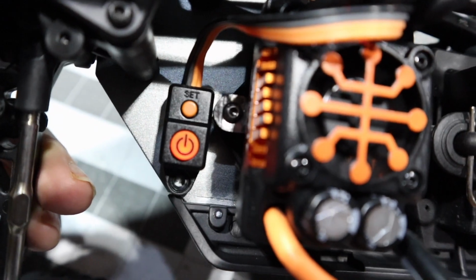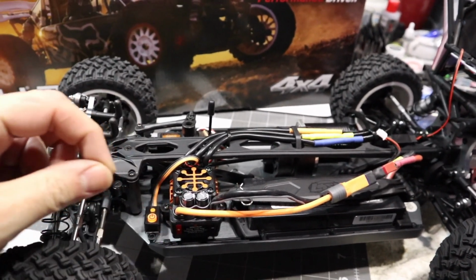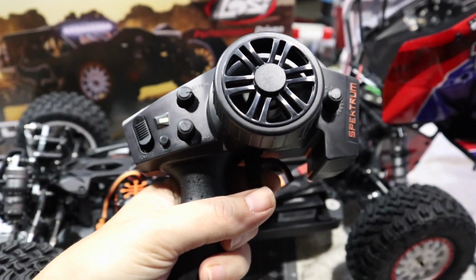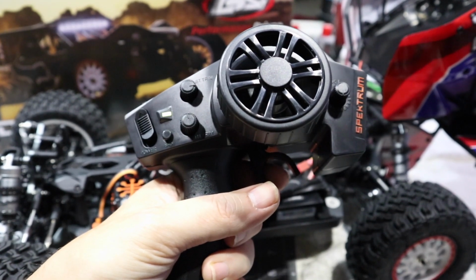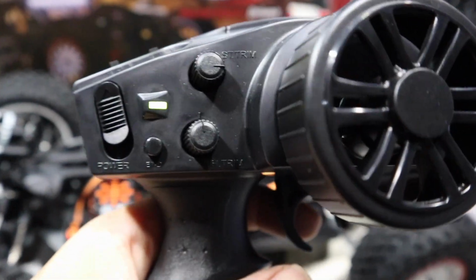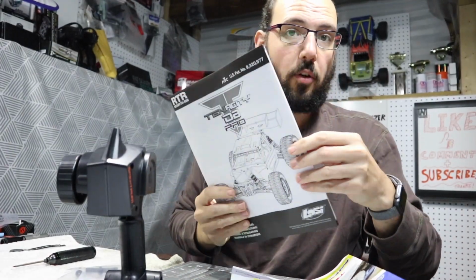And we have a button that will not get jarred based on impacts. It is a push button start, which is cool. On a lot of RCs where it's a toggle switch, you have a really hard impact and then the switch turns off. Now I should do radio calibration, but I just quickly check to see how much engagement I have before it starts. I've got a little bit, so I could improve it, but we'll see. And then reverse is also very sensitive, so it's close. And I might want to adjust my steering trim too, as it looks like it's quite a bit off center.